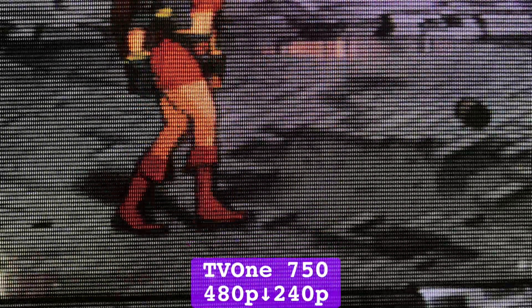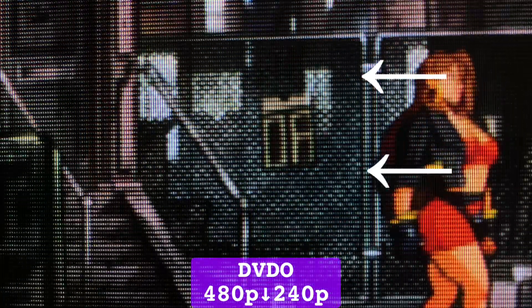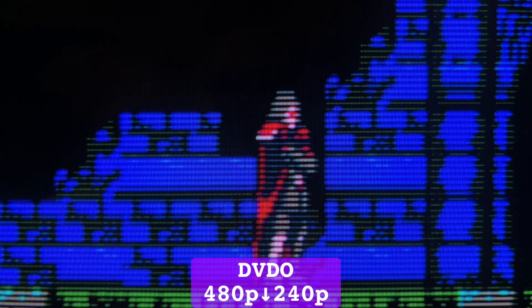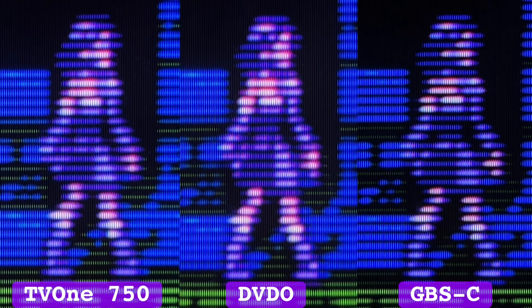The TV-1 750 smoothly averages the Y axis to mellow the picture, keeping those floor tiles looking static. As predicted, the DVDO scales in much the same way as the Koryu, with smooth vertical panning. But it also suffers from aspect ratio hiccups, resulting in regular intervals of uneven rows, which causes anything that passes through to warp and curl. Line blending results in a fairly accurate representation of 2x upscaled 240p video, but also produces a ton of blooming. The Koryu 2 and DVDO may appear brighter on these captures, but the GBS control looks much cleaner and more accurate in person.